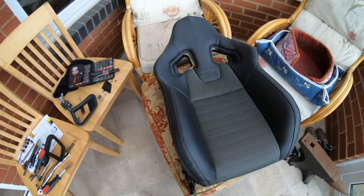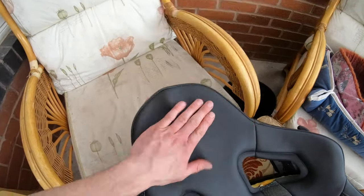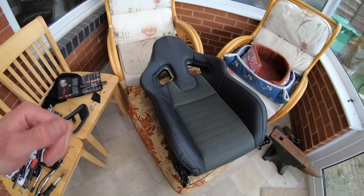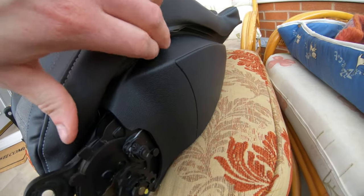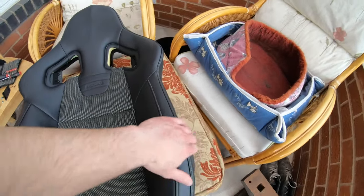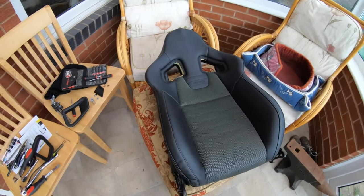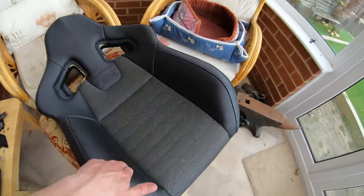When putting this back together, with trim you want to give it a bit of a slap and a beating to get it puffed back out and pulled tight. But here, see this foam? It's lipped — it goes over the outside of the bolster. Make sure those lips are over before you roll the plastic clips behind the lever 180 degrees back into the channels. Go around and make sure it all looks right and it's good to go.